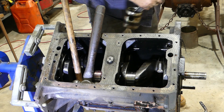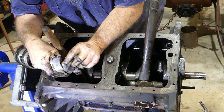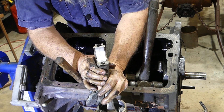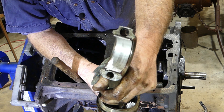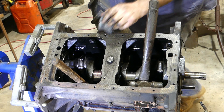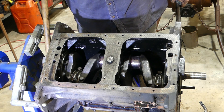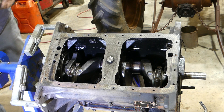There we go — once again we still have the assembly grease on there. But if you have a look, can you see that mark through there? Whoever's put it together hasn't been all that clean. We know the engine hasn't started and we know they're new bearings, but there's been a little bit of contamination — they haven't been all that clean when they put it back together. You can see a little run around the bearing and it hasn't even run yet. That's how cleanliness can affect it. Well, that's an interesting thing, isn't it? No compression anyway.